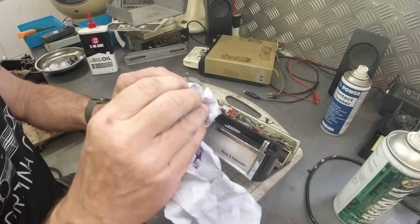It should come off. There it is. So that's damaged. You can see it's distorted. I don't know the correct shape, so we're going to have to get the other 8-track and copy it. Hopefully that one on the other 8-track's not damaged, but that wasn't in good shape. There's the tower. Supports it. There's the cam from that side. If we pull the solenoid here, it's still sticking, so it's not that either. There's the head adjuster.